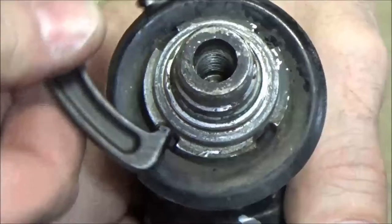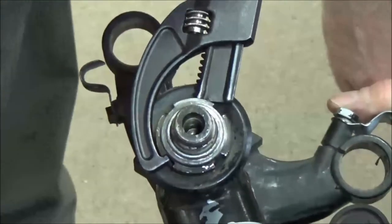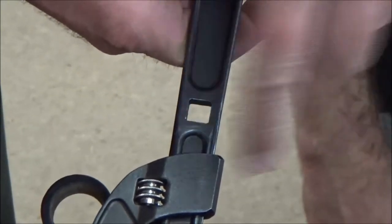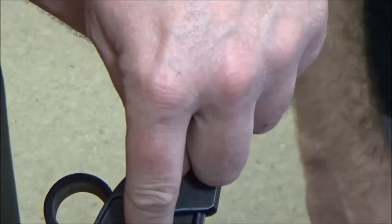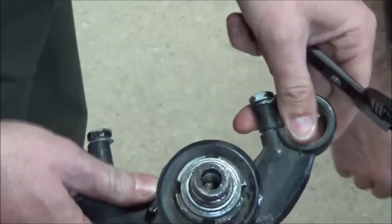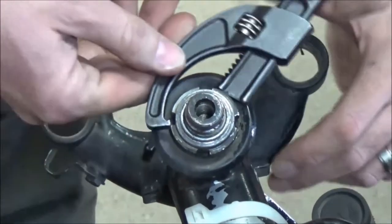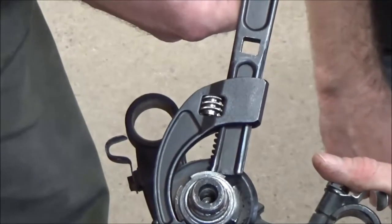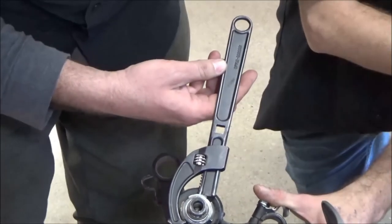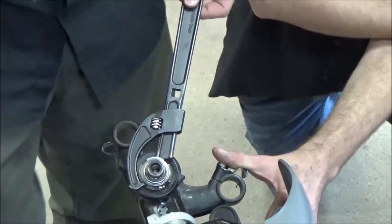On installation, obviously we've got the same thing going on here. Here's what's cool about this tool: go to the other steering lock — look at what we've got, a 3/8 drive. Now we can put a torque wrench in here because there's a torque spec in the manual for this. We're going to put some new bearings in. If I put a torque wrench at 90 degrees to the extension, that cancels out the extension and I can go to 22 foot-pounds, or whatever it is, and life is good.